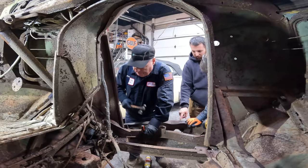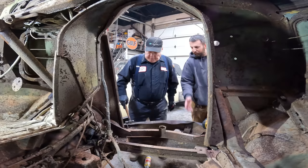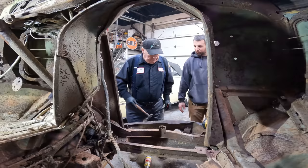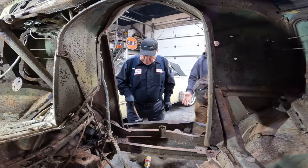This outside, once we get a bumper bolt in it. We get a bumper bolt in it, and let's go with a better plan, but we want to try and suck this in a little bit if we can. I don't know if we just try running it over with the skid loader, or take it off and get it on some blocks and push down on it in the middle, or maybe we get a bolt in it and come along to that engine cross member or something, pull on it, or the front axle. It ain't a huge deal, but if we could get it in just a couple inches.